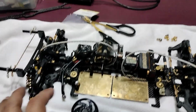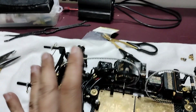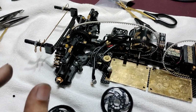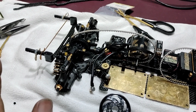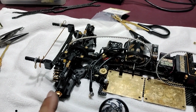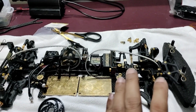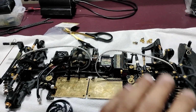How did I set up? Any tips? Well, rather than changing things on the car, the track itself, with new tires, the car will be very sharp, and when the tires are used for the second time, it will go to a more understeer setting, understeer tendency. So first run, I would typically, initially, when my driver was not used to the steering, use a weaker traction compound in front compared to the rear to make it understeer a bit.